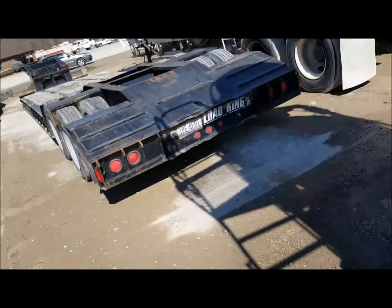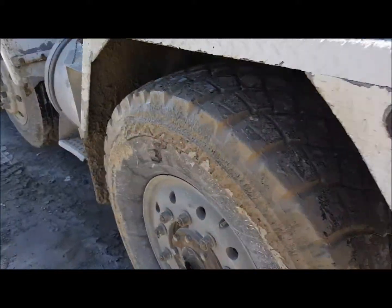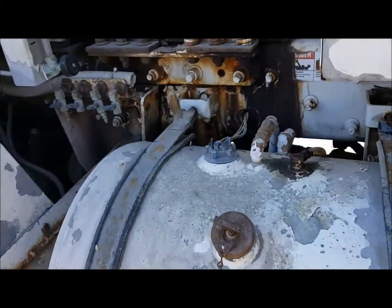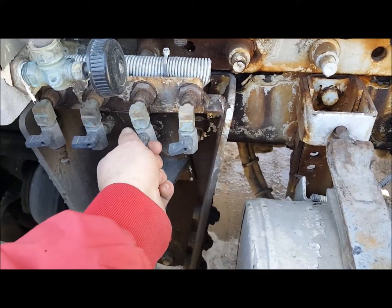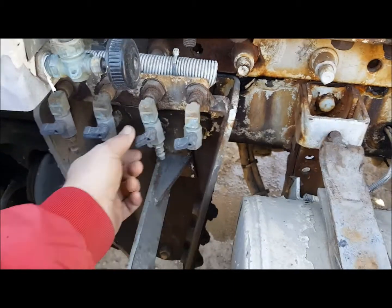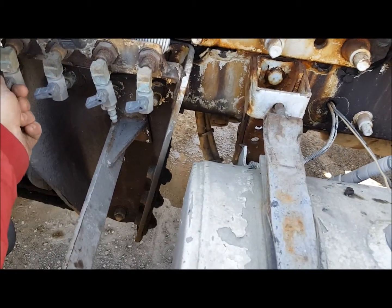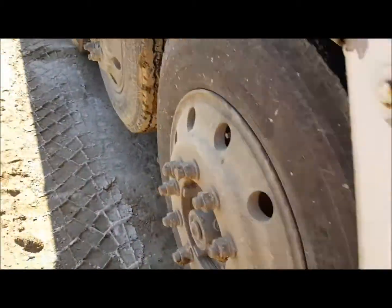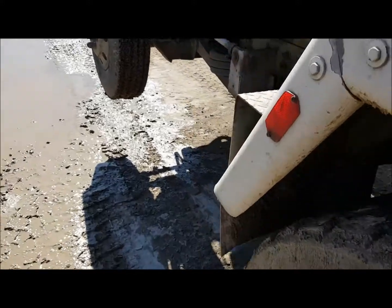You go around to the other side of the truck. Barely crack your air valve — barely crack them. If you do it too much, it'll get them to flow into the air. If you barely crack them, it'll help pull the water out of your system.